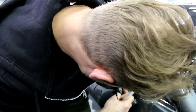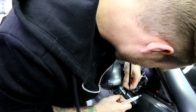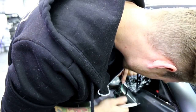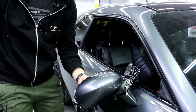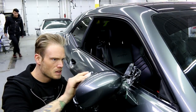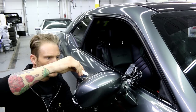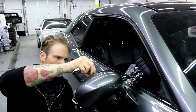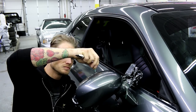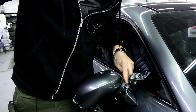I pulled the wrong one — but it's all good because that's around the bottom anyway. I got wrapped up in here. So I pulled the wrong one — no big deal, I stopped soon enough. But I cut that string so I'm going to have to go from the inside of the mirror now. This is what happens when you have too many pieces of knifeless tape. I'll cut that, cut that, some of that. Now I've got my hand on the knifeless — perfect, that's how that worked out fine. It didn't ruin anything, luckily.